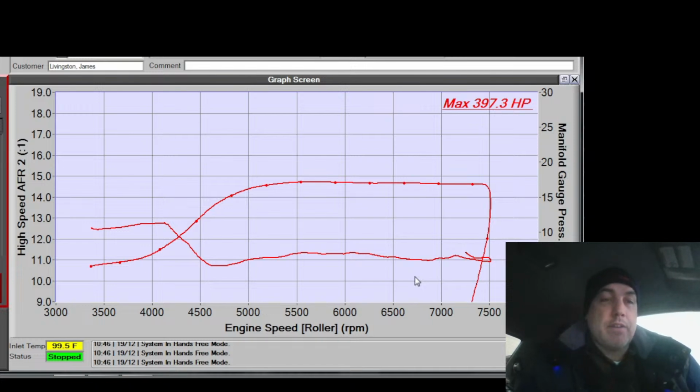Now, I was talking about idle air when it crashed last. So I'm going to add a little bit to the decel adder, and then I'm going to add some to my minimum airflow for decel. That'll make it flare a little more when you're decelerating, not go as hard. And then I'm going to go to my throttle tables to my target idle air there, and my minimum airflow there is 5, and still it says 2 something. That's annoying. I let off, it goes to 2. Where is that?